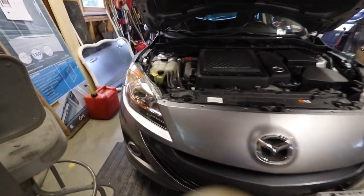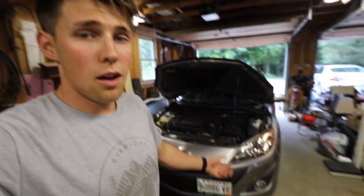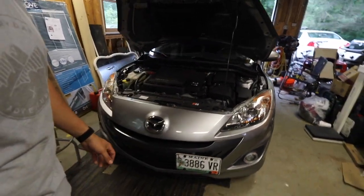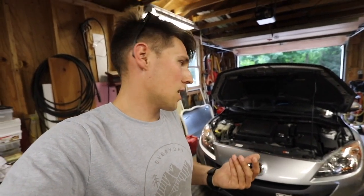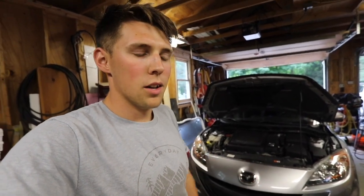There was no sanding involved with this. All you had to do was just polish the lens and it goes quite a long way. If it gets hazy again, I'm probably just going to use the wet sand technique like I did in the New Lens review, and then seal it — which is another product you have to get. But for now, this worked just perfect. That's all I really needed just to touch up, get the haze off the top and make it look a little better. That's going to do it for the video today, guys. I hope you enjoyed — just a really simple trick that not many people know. A lot of people think they need new headlights when they're hazy, but really you just need to polish it and it'll be good to go. Thank you so much for watching and I will see you guys in the next one.